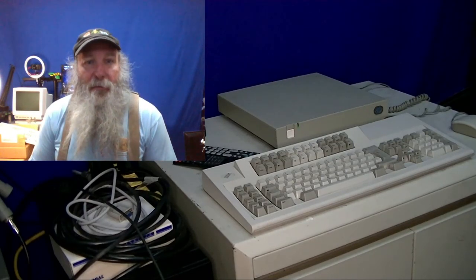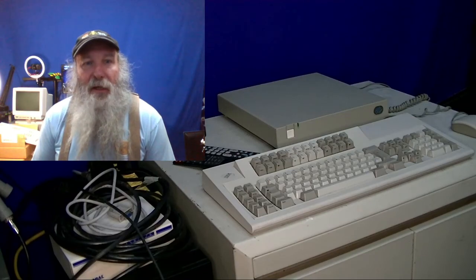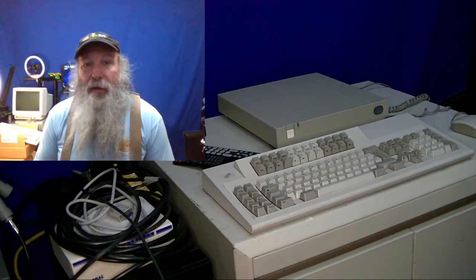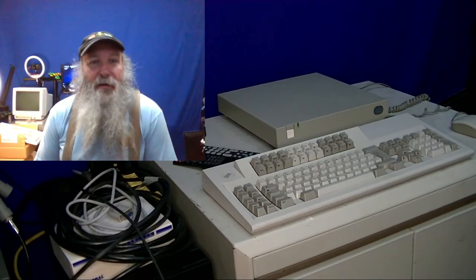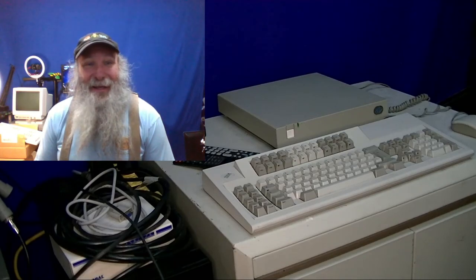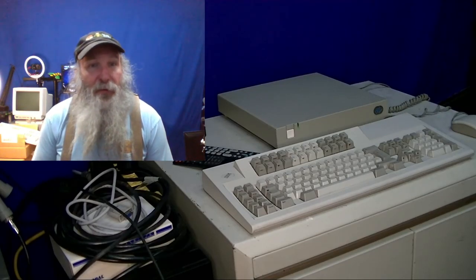I'll go through and get it set up for that system console, and I could even go through and set other areas and toggle between those display sessions — to show what's on the system console and even other display sessions. It would be kind of neat. I do have printers around that I could maybe find a model close to or emulate for those models, and even set up a printer for my AS/400. I still have to figure out that DB15 connection for connecting into a host — this is clearly designed to work with a twinax or AS/400 system.